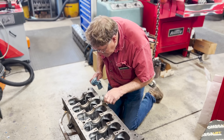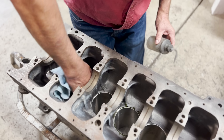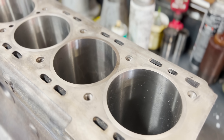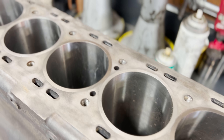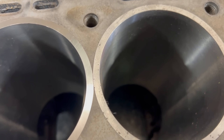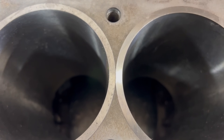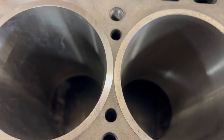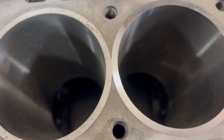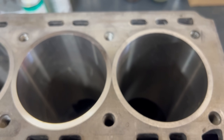With all the sleeves installed I put my cleaning guy to work doing what he does best. The excess Loctite had pushed out of the bottom of the bores so we wanted to get it cleaned up while it was still somewhat wet. We really couldn't have asked for a smoother install on all six of these sleeves. What seemed like an intimidating process to begin with really didn't end up being too much different than all of the machining methods and practices that we use in our day-to-day work. We're confident that the top hat sleeves are going to be the key to saving this block for our customer's restoration, and at this point we're basically back to where we started with the block needing a rough bore, finish hone, and surfacing of the deck — but all of that will have to wait for the next video. Thank you all for watching and we'll see you in the next one.